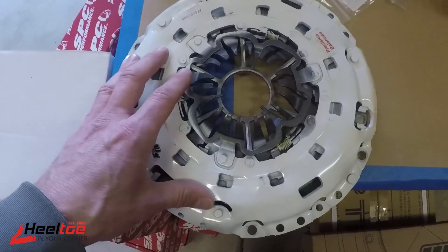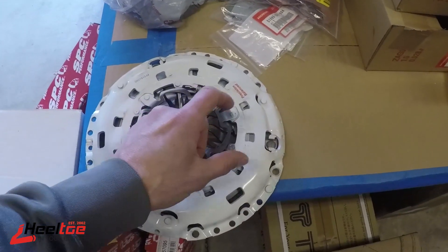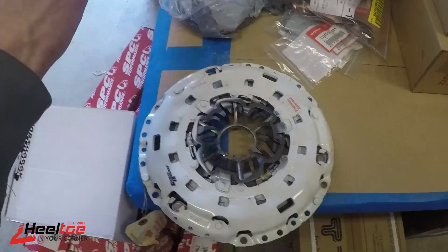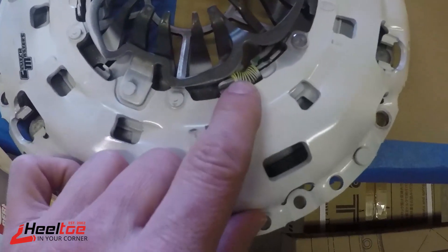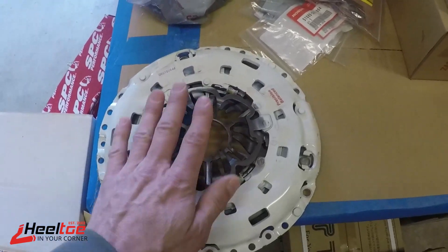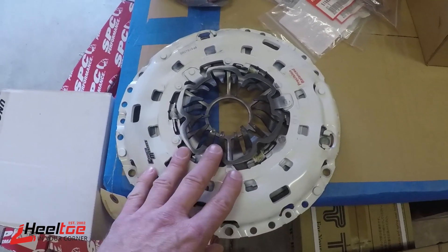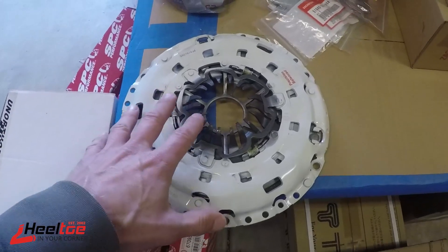It also has a downside because people get these installed wrong all the time. I was recently underneath a '07 TL Type S and there's a sticker that says 'please refer to the service manual for correct clutch installation.' A lot of people come back claiming their tech is an Acura master tech, but people just slam these on and think they've installed it correctly. You'll get weird pedal feel if it's not set right. You can see these springs here are preloaded, which means the pressure plate is all the way ratcheted open and ready to be installed. If these preload springs are opened up, that clutch is not ready to install — so make sure your Acura master tech knows how to read a service manual first.